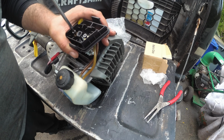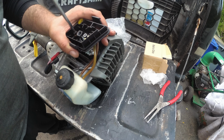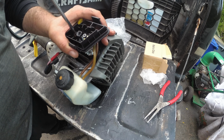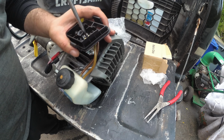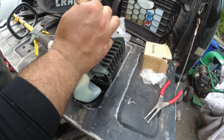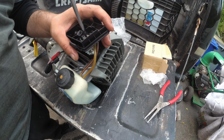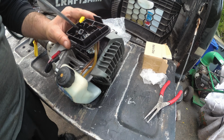Still running, I shut it down. Replaced the O-ring. Put new oil in it, and it was still smoking. It was consuming oil faster than I could put it back in there. So it's going to be another video, unfortunately, on swapping the engine. And it's all my fault because I had that thing for 2 months over that stupid bracket. But it is what it is, right? And there really is no live and learn because I can't sit there and watch this thing run for 10 minutes getting the oil on. Can't make money like that.